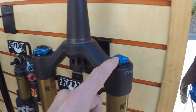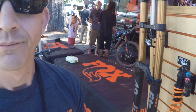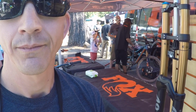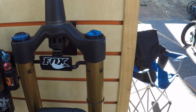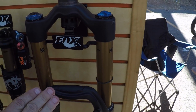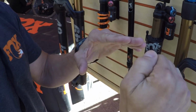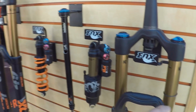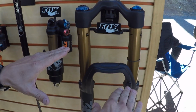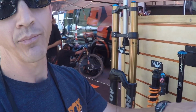And then this is an air fork, so under this is just a valve, so you could pump it up. There's preload when you have a spring fork. So if you pump it up with more air, that's for a heavier rider? Yeah, and then what we do on the inside here is this piece, we call it a bypass port, and the seal sits right on it. It's specially designed so it doesn't damage the seal. When you air up the upper chamber, and this is that static, no load, it can actually sneak past that seal into the negative chamber, so they're both the same pressure starting.